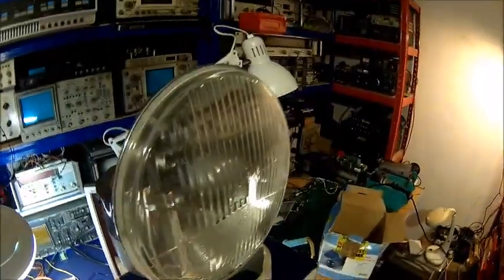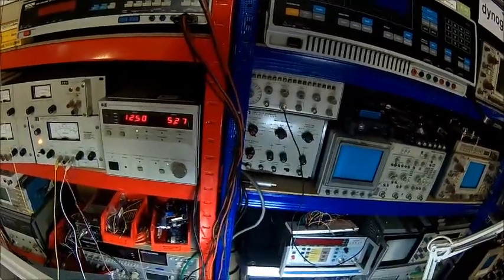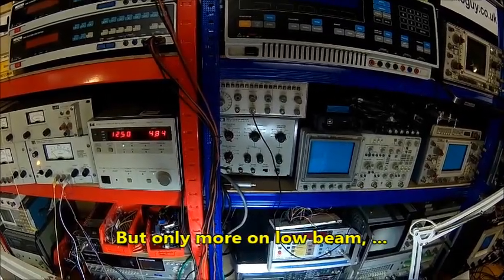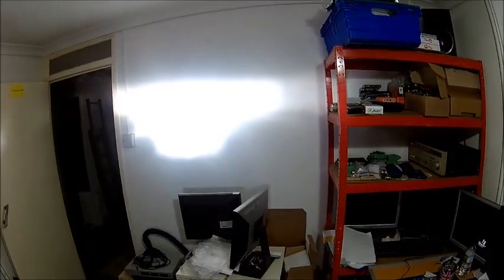Apparently what they do is they just stretch the limits to the positive tolerances, and you can see that here. On high beam it's 5.3-ish amps, and low beam is 4.8 - so that's a little bit more, I would say 10-15% more. And look at the pattern - that's low beam and that's high beam. It looks a lot brighter. Let me turn the lights off.